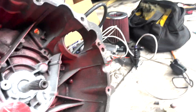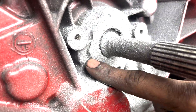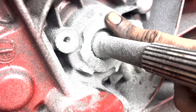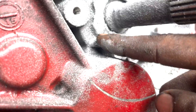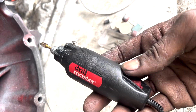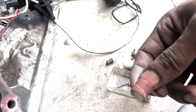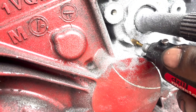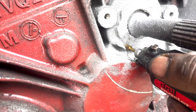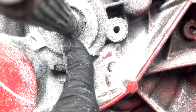All right guys, this is day number four. Last night I called it quits a little early, but today our objective is to flatten out the three tabs on the transmission. Tab one is pretty flush — I'll do a little last-minute cleanup. Tab two is the same, really flush. Now I'm on tab three. I'm using a Dremel with metal bits to get the rougher parts first, and once I get really close to the end I'm using these little sanding rolls. I think I've shaved all three sides pretty much to the point where everything is nice and even.